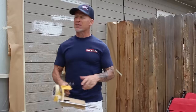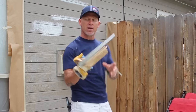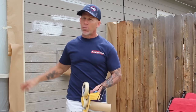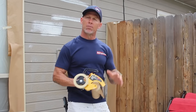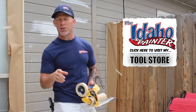When doing this masking, I use my 3M M3000 handmasker with 9-inch paper and 1-inch tape. To keep overspray off glass and windows, we use 72-inch masking film. All the tools you're seeing me use — the cardboard shield holder, the masker, the gun extension, the tips — can all be found in my Idaho Painter Tool Store. Just click the link to purchase my tools and accessories.